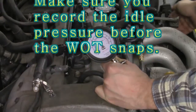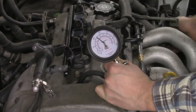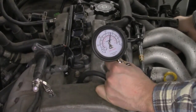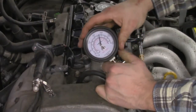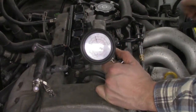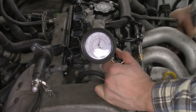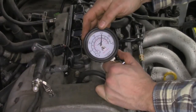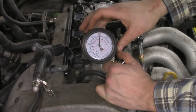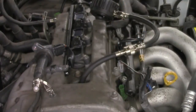I'm going to give it a couple of throttle snaps and we're going to see where we're at. [Throttle snaps] Alright, a couple of snaps takes us all the way up to about 175 psi. We'll go ahead and wide open throttle and hold it for just a little bit. We're reading at 200 — that's a pretty good reading. We'll go ahead and shut it off now.